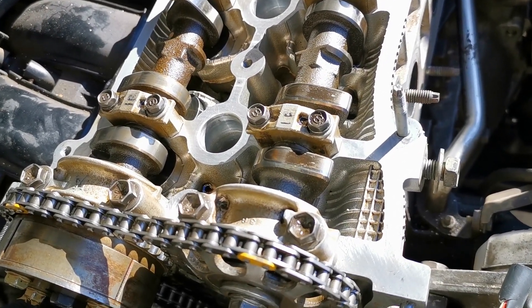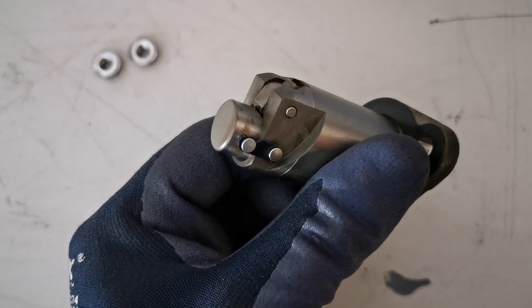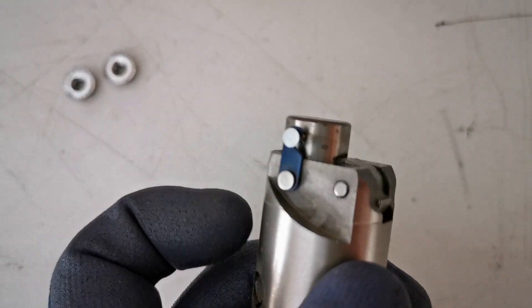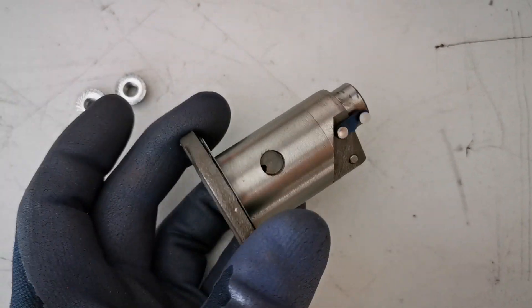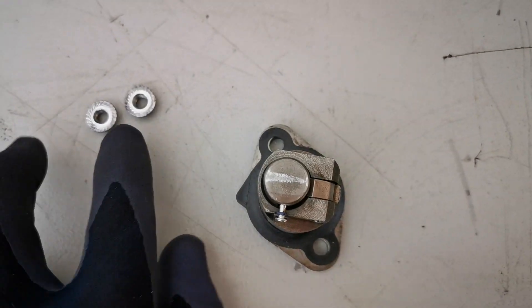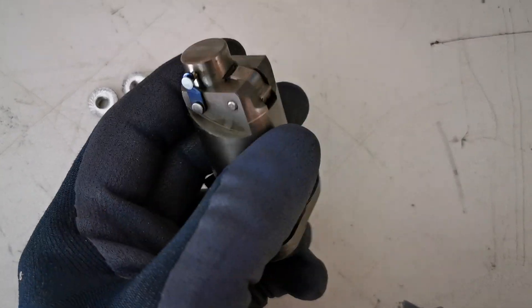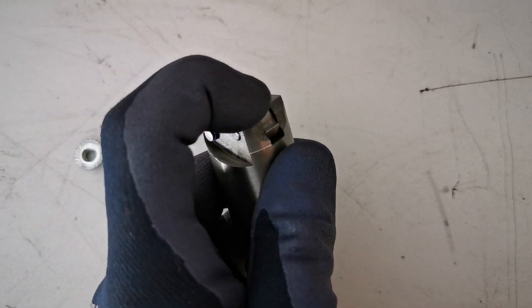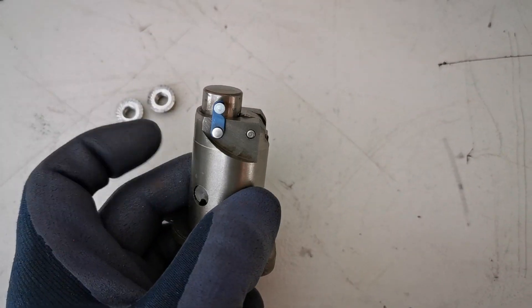Lastly, I'm going to show you the tensioner side. This is the chain tensioner — the timing cover is on and I'm about to install this tensioner. That is the little hook that hangs and keeps it compressed back. You install this — it only installs one way so you can't do it wrong — put on the two nuts, and then you rotate the engine around until you hear this disengaging. This will press against that and release, so you'll hear it starting to ratchet and the clicking will happen until it goes out and sets the tension.